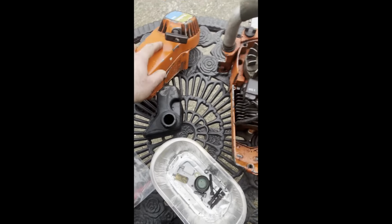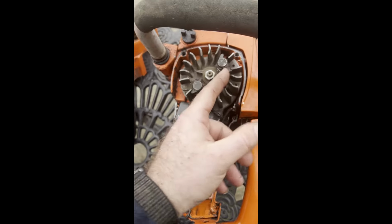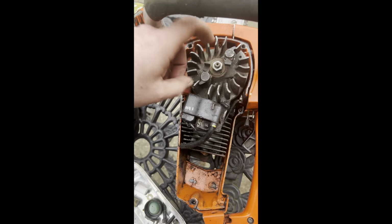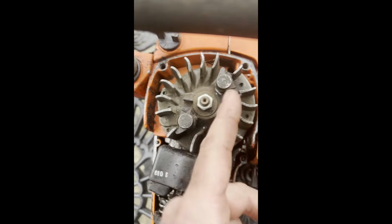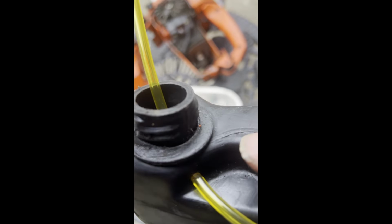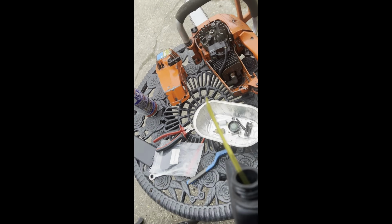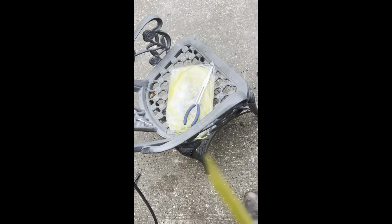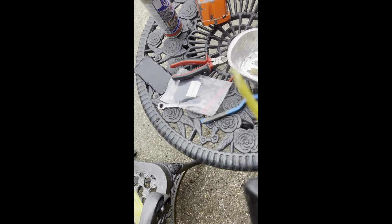Cleaned up in there, got rid of all the goober. Cleaned the tank, and I've greased these with the littlest of oil, and there they spring. That one moves lovely, and they're the same. So I'm going to find a bit of fuel line and treat it to a new weight. That's a really tight fit in the hole, so to sneak it in, I've cut a long sliver on that so that I could reach in with the fishing pliers. There, look, I've cut a point on that, reach in with the fishing pliers and grab it, and then I'll flush cut it and put the weight on.